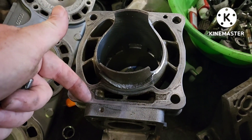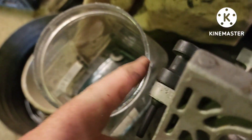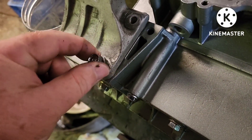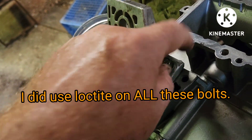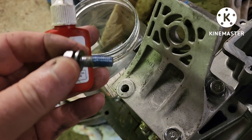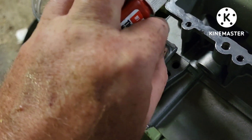You can see each one — they have two. So you put your pins on. It's kind of hard to mix up which mount goes where because of the fact that this little rubber piece, that cover slips over that, so you can't get those confused as to what goes where. Then your four bolts putting that back on — it's got line-up pins, bolts, put it back together. They were the last thing I took off, first thing I'm putting back on. Don't forget your threadlocker on all these bolts — you don't want them coming out on you. And then the other side, same thing.